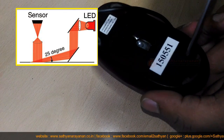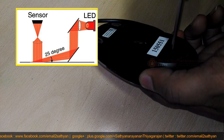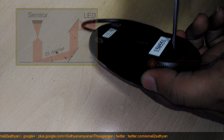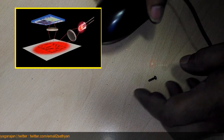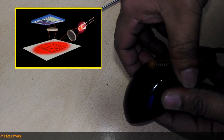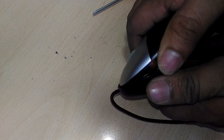The photo cell has a lens in front of it that magnifies the reflected light so the mouse can respond more precisely to your hand movements. As you push the mouse around your desk, the pattern of reflected light changes, and the chip inside the mouse uses this to figure out how you're moving your hand.